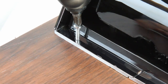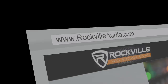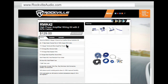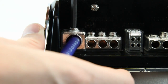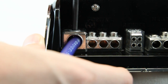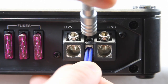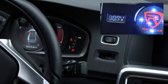Now for permanent installation into your car, mount the unit into place using the screws in the kit. We suggest checking out rockvilleaudio.com and purchasing the appropriate Rockville car audio wiring kit that will match with this system. Now loosen the positive terminal on the capacitor and run a zero gauge positive wire from the battery into the positive terminal of the capacitor and tighten it down. You will also need to run a thinner remote wire from the capacitor to the plus 12 volt remote terminal on your amplifier.